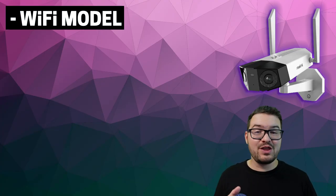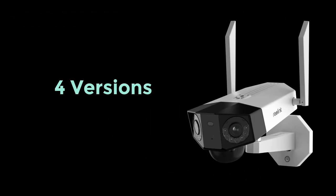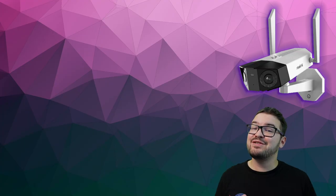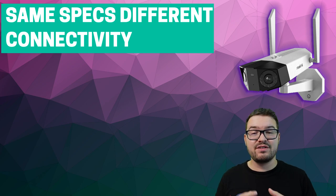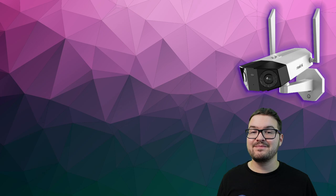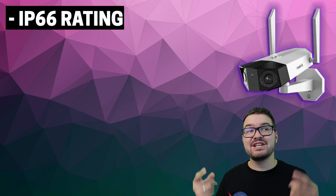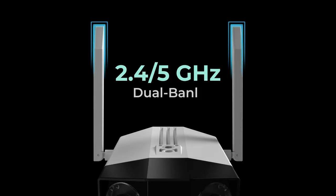In this video, we're looking at the Wi-Fi version of the camera, but you can also get 3 other models. You can get the PoE version, the battery powered version, and the 4G version. Each of the 4 camera models have the same physical camera specification, but they've got different internals to offer different connectivity to match your needs and locations. All of the cameras are water resistant and have an IP rating of IP66, and with this being the Wi-Fi model, it can connect to both 2.4 and 5 GHz networks.